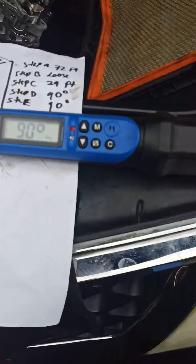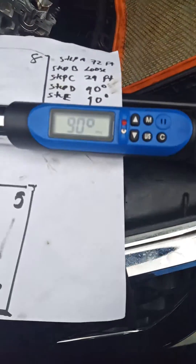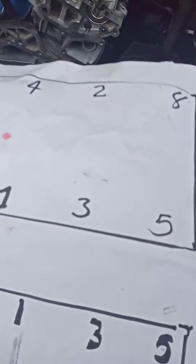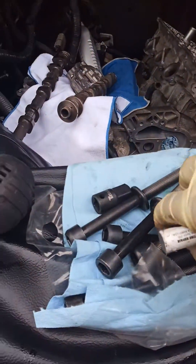If you don't have one of these machines - I found them not very accurate anyway - I'm going to show you how you can do it with just a breaker bar. It's really easy. They call it 90 degrees, and pretty much everyone who took geometry knows that 90 degrees is a quarter turn like a pie slice. I've used this method and you don't need a special digital gauge.